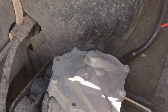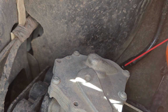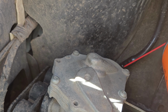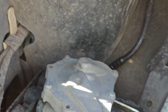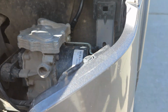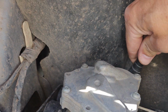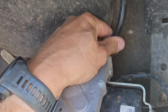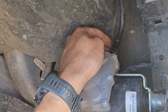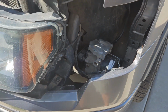What I ended up doing is adding about a 2-second blast into here, 2 of them. So 1, 2. It's probably a little bit less than 2 seconds, 2 of those. And then after that's done, I put the vac tube back onto it and get it down to seat. And again, like I said, the clip's not in there. Make sure that the clip's not in there or you could break it off. And then after that, I'm just going into the vehicle.